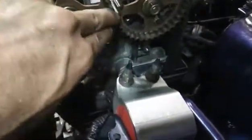After you get done setting your timing, when you bar it, count your teeth — one, two, three. After it rotates three teeth, tighten your tensioner bolt down. Then you have to bar the engine over one whole revolution, bring it back, and make sure you're lined up on the crank. Check that your cam gears are lined up, everything looks good, and tension is good on both sides.